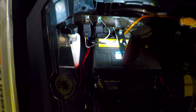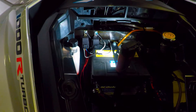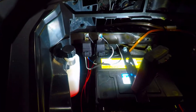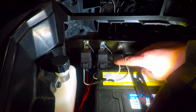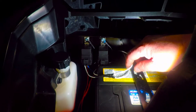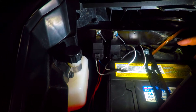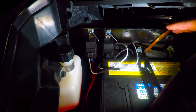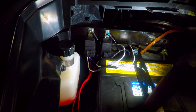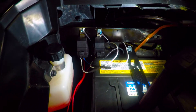For all you guys that don't know how to do a relay, here's a quick rundown. Most relays have five wires but four are commonly used — the fifth wire is for a different wiring method and not used in my application. You have a black ground wire, a white trigger wire that comes from your switch, a blue accessory wire that goes to the accessory you're powering (your output wire), and a red wire which is your input — incoming power. So: red is incoming power, blue is outgoing power to your accessory, white is your trigger/activation wire, and black is your ground.